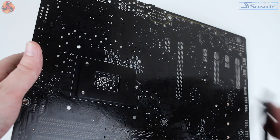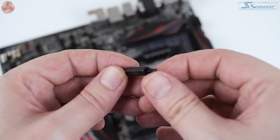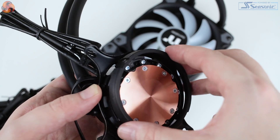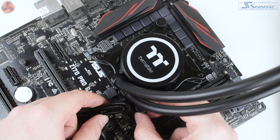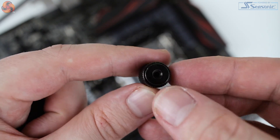Installation, being an Asetek-manufactured cooler, has been refined to absolute simplicity. For our Z170 test bench, all you need to do is adjust the mount on the back plate to ensure they pass through the motherboard mounting holes and sit the back plate in place. Four double-threaded standoffs are then screwed in to hold the back plate. The block needs to be set up with its own specific mounting bracket — one is included for Intel and one for AMD — and it clips on using the plastic retention mounts. Thermal compound is included but was removed and replaced to ensure consistency with our testing. Mounting the block is then a simple case of placing it atop the CPU and firmly tightening it down with the four included thumb screws. Overall a pretty basic process which only takes around five minutes.